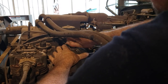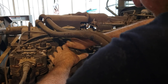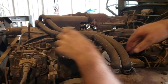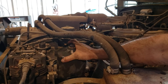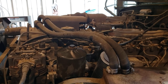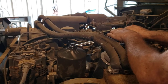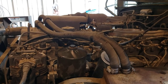What you really don't want is the canister spinning when you're tightening it — that will cut the gasket. Shake it and make sure it's seated. You've got to make sure the canister lip isn't up on top of the lip of the filter base before you tighten it — that's why I shake them a little bit. Sometimes they'll get like that and then pop down when you shake it and turn it. Good old 7/8 wrench — snug it down. I don't actually torque these things, but what I did just there is more than good enough.